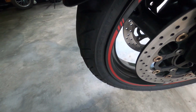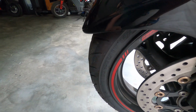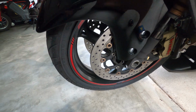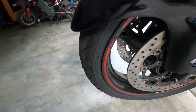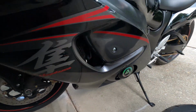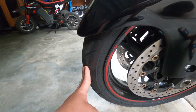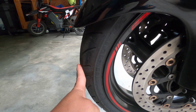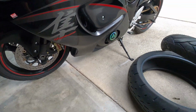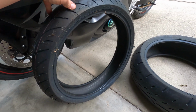There is, I don't know if you guys can tell, some unevenness on the front tire. I started doing some burnouts and stuff, and holding the brake on the front tire, I think it puts some wear on it. You know, the bike trying to push forward and holding the brake, and I can really feel a wobble out of this distortion that created here at high speeds. It's actually pretty scary, but we are gonna go with a smaller profile tire.